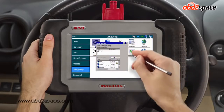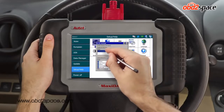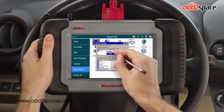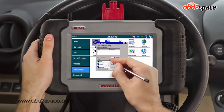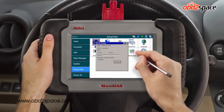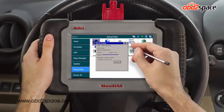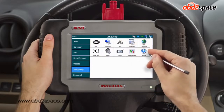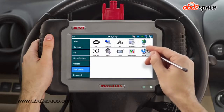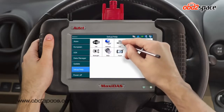The first icon on the left is the Wi-Fi configuration. Click on it and you will go directly to the WLAN settings where you will be able to log on to your wireless network. Delete any networks already listed in the Preferred Networks box by pressing on the network until a small option box opens and hit delete. After you have deleted these networks, select the network of your choice in the Active Networks box. If you are using a secured network, you will be prompted for a password. Simply type the password on the keyboard provided and hit OK. Look at the bottom LED light next to the wireless symbol. If it is green and the icon next to the Internet Explorer icon at the top right of the screen is green as well, you are connected to the Internet.